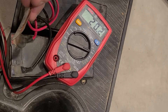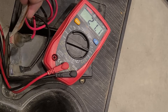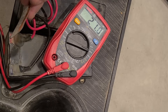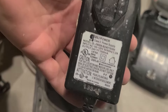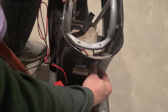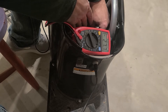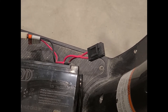I did a couple of quick checks to make sure that the batteries were the likely problem. This is two 12-volt batteries wired in series, so they should be showing at least 24 volts and we're getting about 21 — so yeah, probably a battery issue. I also checked the charger itself, made sure it was outputting the right voltage, which it seemed to be. I plugged the charger into the scooter and then measured voltage across that clip we unclipped, and that seemed fine as well. So let's order some batteries.